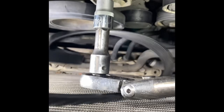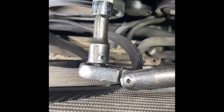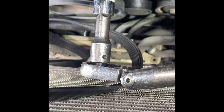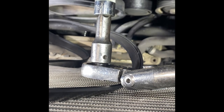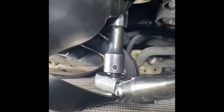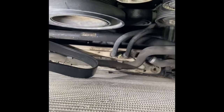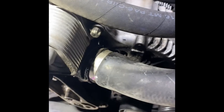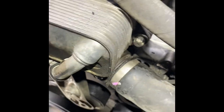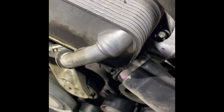They put this N55 engine in a variety of vehicles, so the belt drive setup is a little different but generally they'll share a couple of pulleys. If I'm doing any oil filter housing oil leak job, I'll probably remove the belt — or if I don't remove it, I'll get a paper towel or a rag and cover that area so I'm not getting oil on the belt.